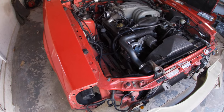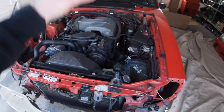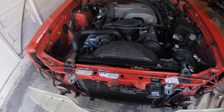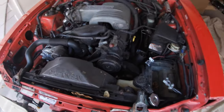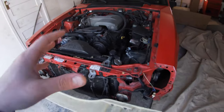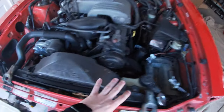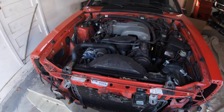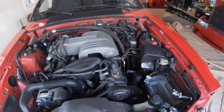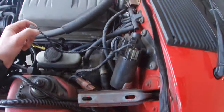While the car is on the ground, get all the header bolts off, then jack it up and put it on jacks. Remove the bolts from the headers to the H-pipes or the exhaust. Still just in the preparation part, pretty much still getting the car to teardown. Hopefully by the end of the day I could mock up — put the headers on, crossover, set the turbo right there — just to get an idea of how dope this is gonna look. And I'm gonna try to clean too while I'm at it.